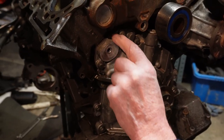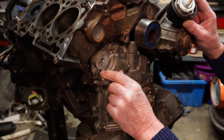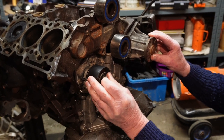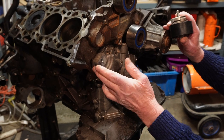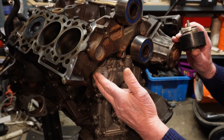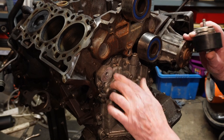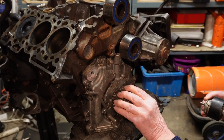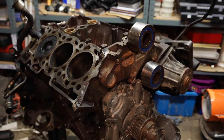The earlier oil pumps didn't have this strengthening piece here, and these were known to break off — so you'd have a hole in the top of your oil pump where the timing cam belt tensioner fitted. It used to snap across there. Why it snapped, I don't know — some snap and some don't — but they strengthened it because they found that was a problem. That is your oil pump; to get it off, your front sprocket has to come off. These are your idler pulleys for your timing belt.